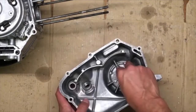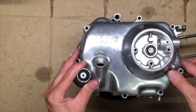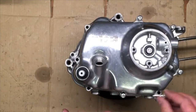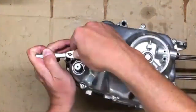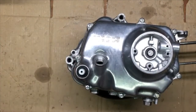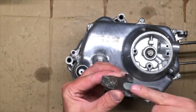In 1968 Honda also started work on a prototype of a bigger version of the Monkey that could carry two people. The engine was upgraded to a 70cc version to meet the demand for more power. The first prototype is very similar to the official first series produced in 1969. Differences between those two were a smaller headlight, like those used on the U.S. Z50A Mini Trail versions, with a small round speedometer. The seat, designed for an extra passenger, was slightly longer. It had an upswept exhaust but the openings in the heat shield were of a horizontal striped pattern. The front fender was high-mounted to the front fork as was done with the CT70 models. The side emblems were missing in the main decals between the front fork and the seat, where the aluminum pressed-on sign was screwed onto the frame.